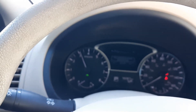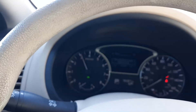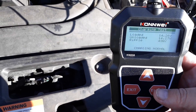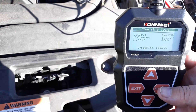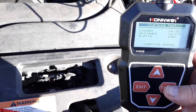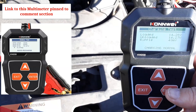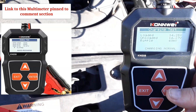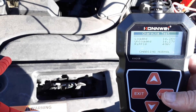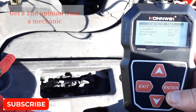Hold it at 2500 for at least 10 seconds — you can go over 2500. It says charging normal: 14.26 volts loaded and unloaded, so that's normal. While the vehicle's on, you want your volts to stay with the lights on at 14.2 — 13.5 is fine as well. But again, if it goes over to like 16 or 17 volts, your alternator is defective. And if it stays at 12.5 with the engine on and lights on, your alternator is bad. Thanks for watching and make sure you subscribe.